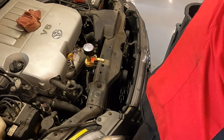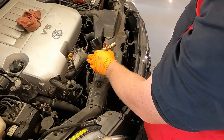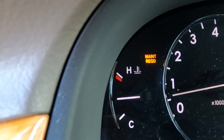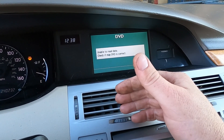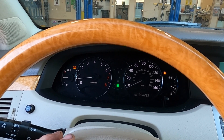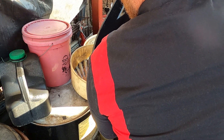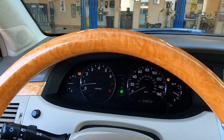We're adding coolant into the reservoir and are essentially ready to go. When you take the adapter off it's a good idea to add a little more coolant directly to the radiator — you don't need very much. This car had a pretty substantial leak so the overflow bottle is completely dry as well, so we'll add coolant to that too. From there we add the cover and test drive the vehicle. With the vehicle up to operating temperature, a trick to tell if the cooling system is fully bled is if the heater is hot on the straight vents, which it does appear to be. Everything's nice and ready to go. The last steps are to clean everything up, properly recycle the coolant — you can look up your local regulations to find a recycling center — and get the vehicle back on the road. Thanks for watching and I'll see you in the next one.